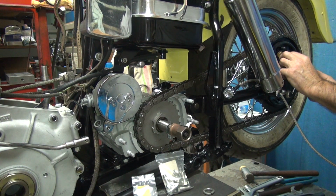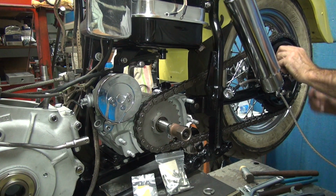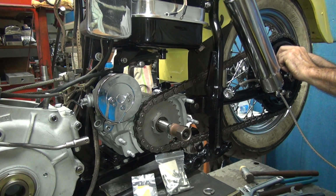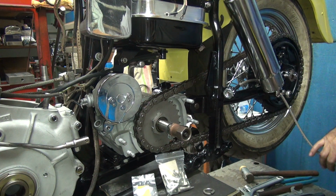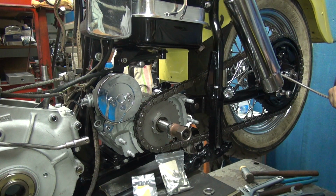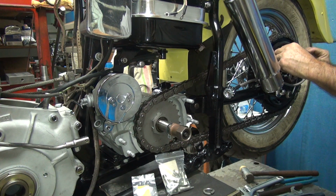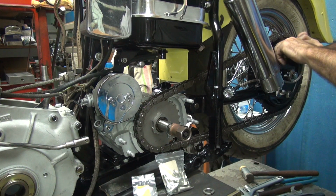The other problem is we need to have a bent hose, which we don't have. Because it's jamming into the backing plate. Usually you stick them in there. You don't need a 45 degree, you need a 30 degree bend. I don't know why they put a 45 degree one in there. Me either. So now I'm going to have to bend the tubing a little bit. That means I got to put it together with a tube on it so I can bend it a little bit.